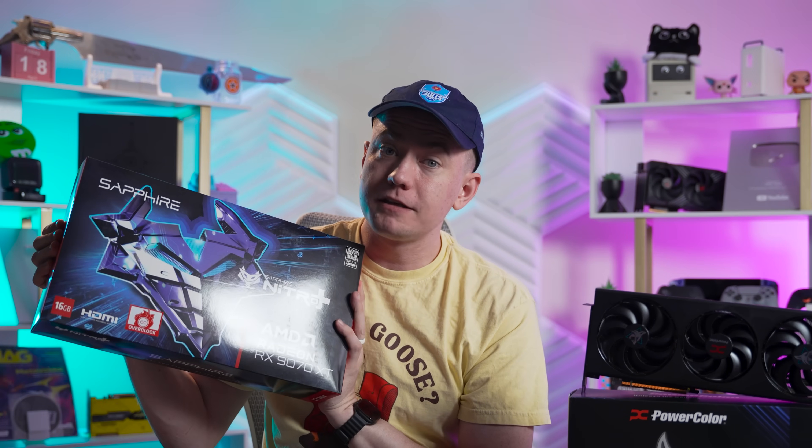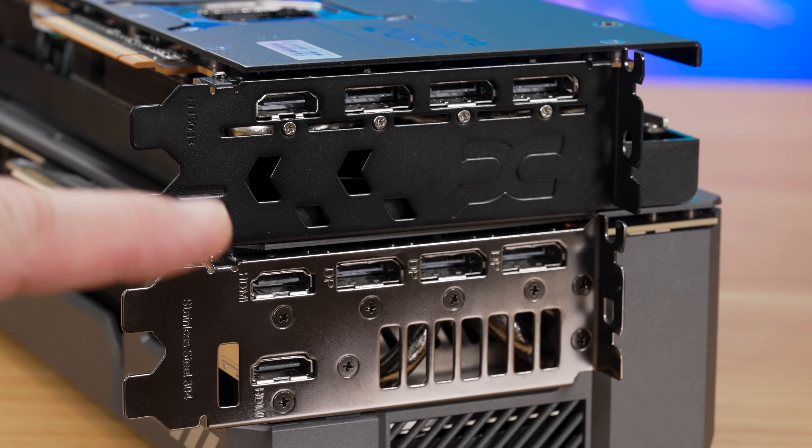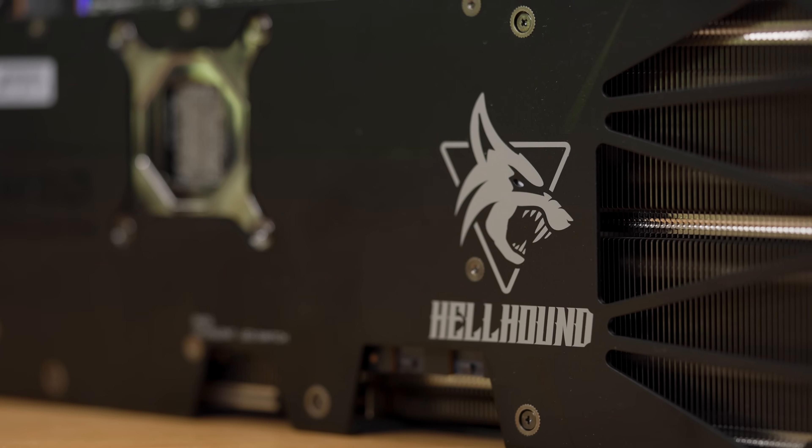Up until May 9th, we're holding a giveaway for this specific Nitro Plus over on our UFD Music YouTube live stream — links in the description. Secondly, your output slots also matter. If your 9070 has three DisplayPort and two HDMI, but the XT only has one HDMI, it can freak the card out as well, so make sure those match. Beyond that, based on our research, you can choose BIOSes from across manufacturers — going from Sapphire to PowerColor, for example. Although I'd personally recommend just getting the fastest BIOS from the same manufacturer or even the same card design.